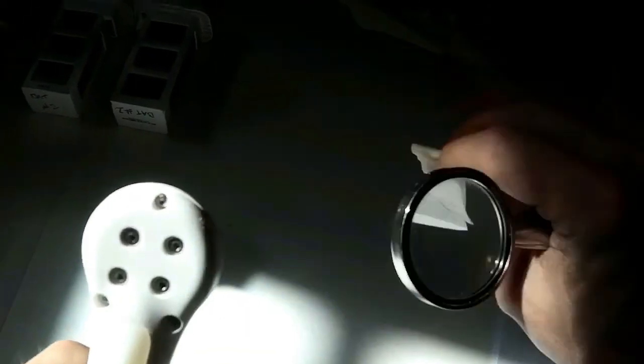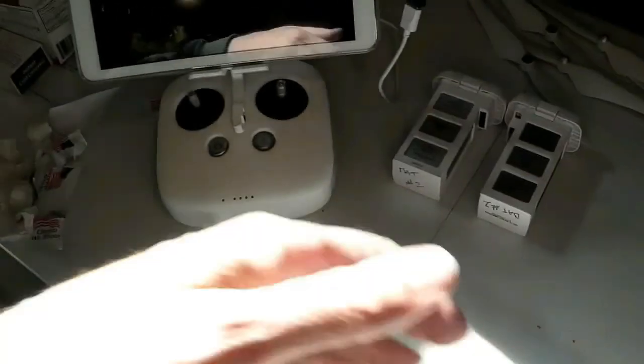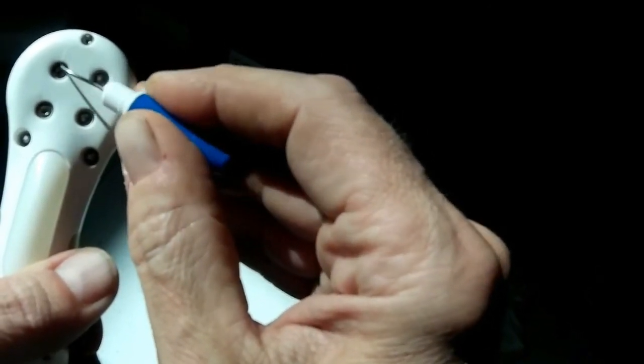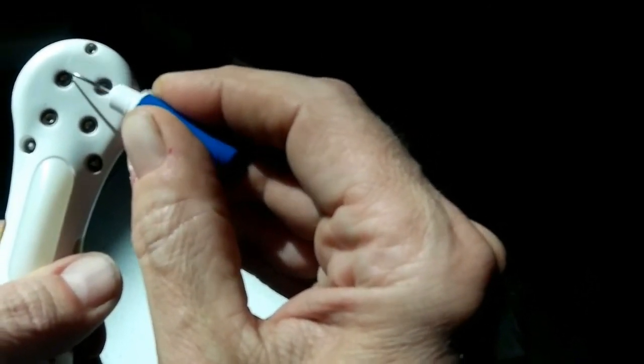The most important part is motor mount inspection. I like to use a magnifier and good lighting to be sure I see everything. The sooner you find and repair a crack, the better the repair will be. You can hear it in my voice — crack. Luckily, this type of crack is easy to repair. It goes from one screw hole to the other, thus terminating itself on both ends. If it had been running out into the surrounding area, we would have drilled some small holes on each end of the crack to stop it from running. We'll come back to this repair in a moment.